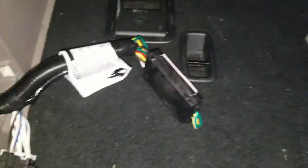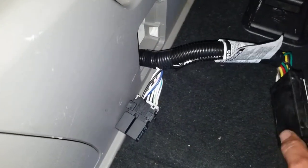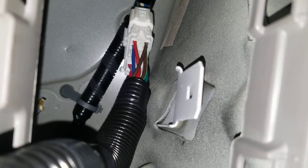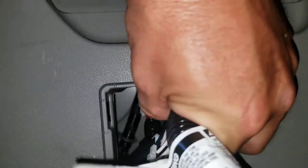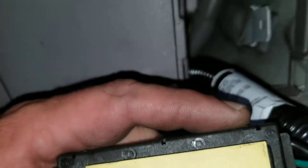The next part is this wiring harness right here. Now this doesn't run down to the other wiring harness - it's all pre-wired by Honda, which I thought was pretty great. I've already reached up in there and snapped it together. You can see that plug - you line it up, push it together, you'll hear it click, you're done. Then you'll have just this small harness coming out with a fuse holder right here. I've already put the fuse in. There's some double-sided tape - just stick it to the back side of the plastic somewhere where it's not going to rattle around.